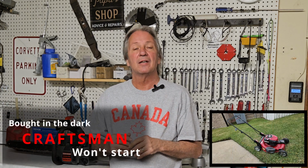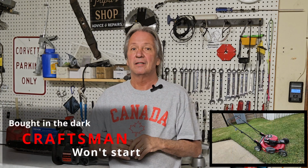Today we're working on a little Craftsman mower. It's got the Briggs Quantum engine, which is my favorite engine in the world, and it just doesn't start. And I've found with almost all lawnmowers that sit for a long time, when they won't start, it's always the carburetor. And we say that all the time. It's always the carburetor. So this time, it's probably going to be the carburetor. We're going to start there.